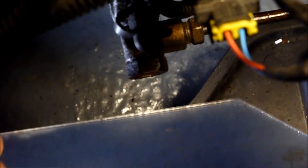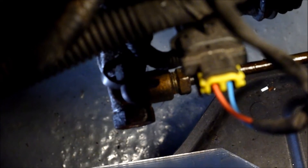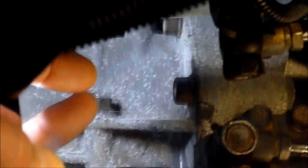I've got a mirror here. There's the connector there — the red and blue wire coming out. If you follow that behind there, a piece of convoluted tubing, it goes right to the crank position sensor, the crankshaft position sensor. I'll turn the mirror and we should come into view.